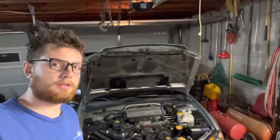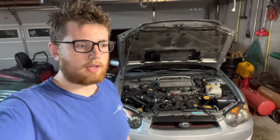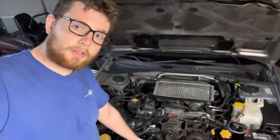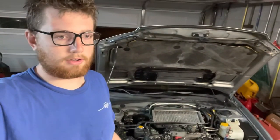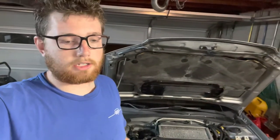What's up guys, my name is Brendan and we're working on a 2005 Subaru WRX. We're gonna burp the air out of the coolant system and lines. Anytime you take this top radiator hose off or any other coolant line, you're introducing air into the system, and those air pockets are causing your engine to overheat eventually if there's too much air in the system.